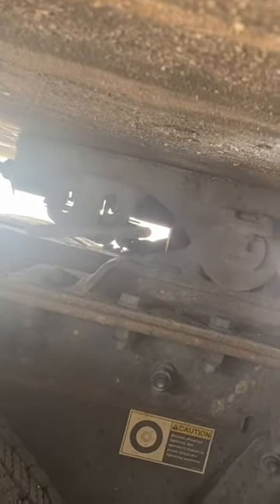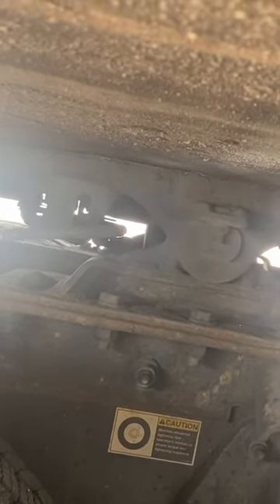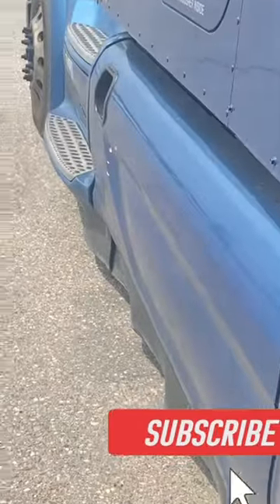You also want to make sure that there's no space at the top in between your fifth wheel and your trailer — the apron. There should be no room in between the top. Then you do your tug test and you should be good.